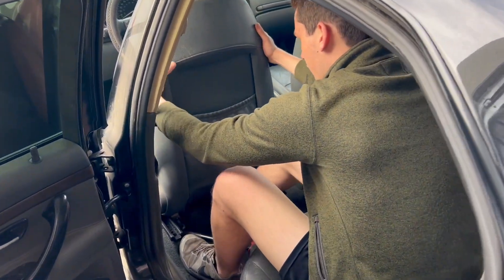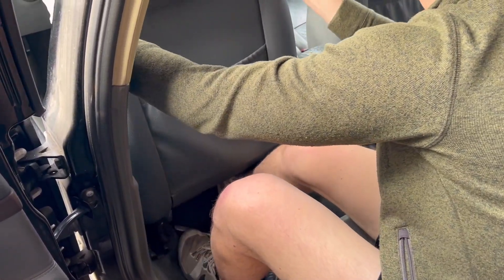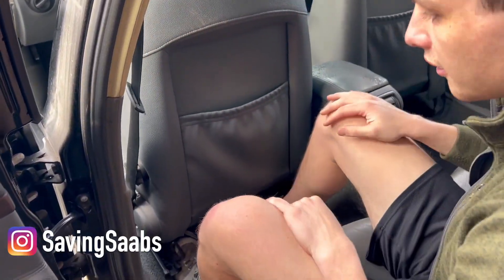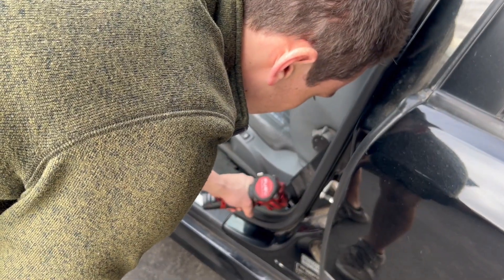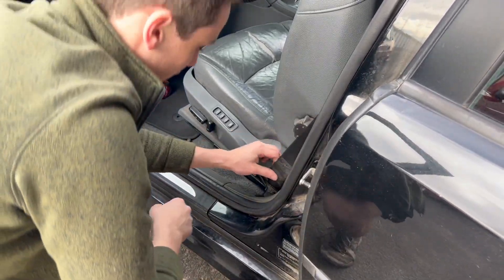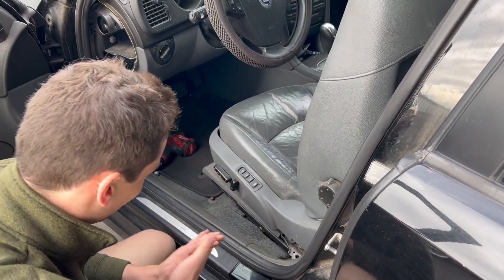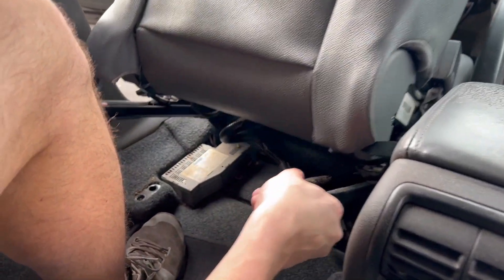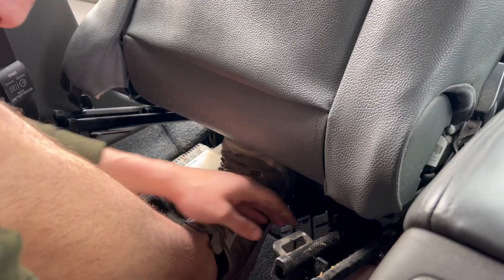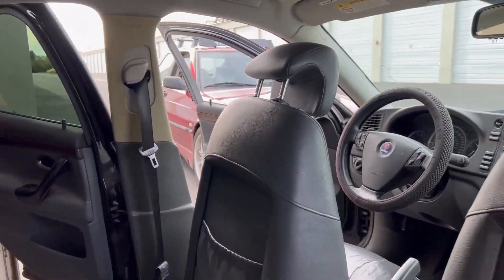Pretty easy to get the seat up from here. You just got to stick your foot under here because there's hooks in the front, and just kind of wiggle it back like that. And then from there, we just got the seat belt down here, which is like an E-Torx. And then there's only a couple little plastic tabs - little sensors on the bottom side. And then we got our harness underneath here - one big harness right down in here. You just got to kind of manhandle the seat while you disconnect it and pull that out. And she's officially free.